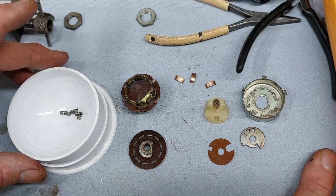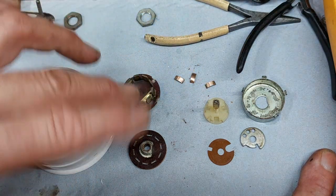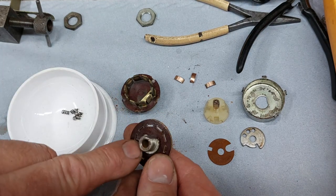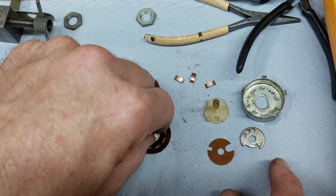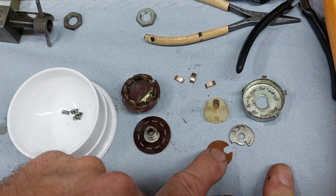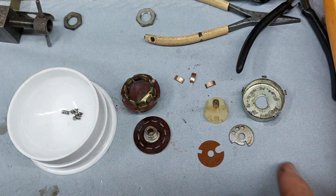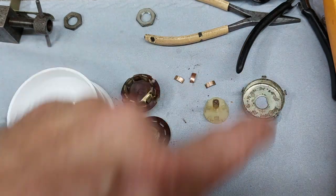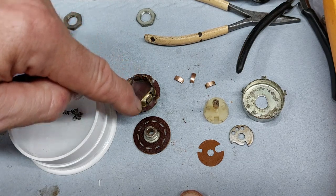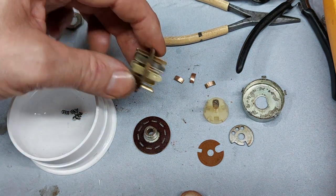It's made up of 15 pieces. So you've got four springs, one ball bearing, three copper contacts. And you've got the switch support on the outside with a fitting for the switch shaft to go through. And then you've got your switch cam indexing plate there, little friction plate there, and then the drum that holds the three contacts and the ball bearing and all the springs. And the case. So what we've got to do is put it back together. Now, and this is why we're on the wiring diagrams, Y10, although it's not used, always shorts to two. It's got a shorting link in the body of the switch there, so it must be used on other applications.